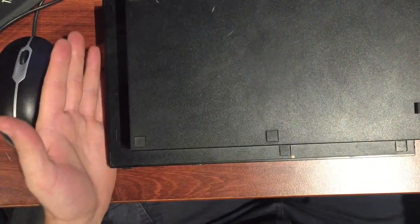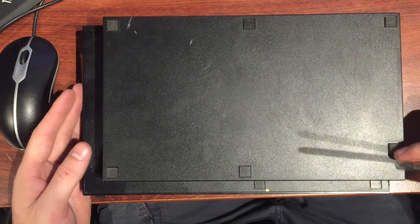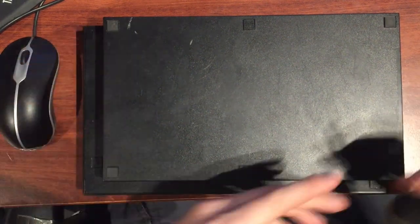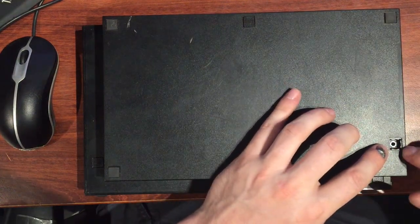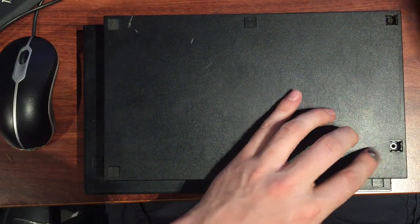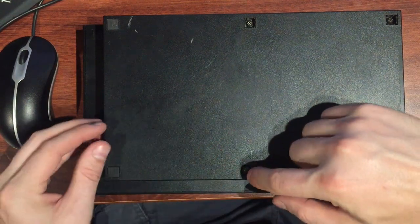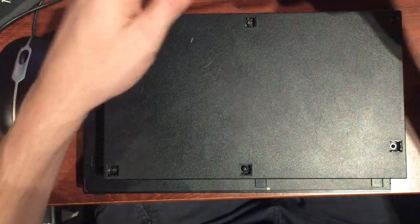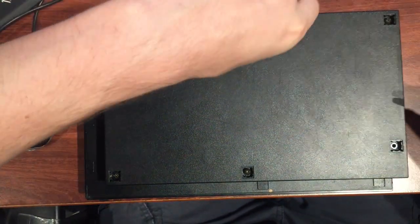So first thing we need to do today is pull it apart. I've never had this apart before — in fact, I've never pulled a PS2 apart before. So I'm guessing we take out these six points here, maybe some around the edge, and we'll work that out as we go. That was already half lifted out and the screw was missing — good start. Let's just grab a Phillips head and pull out the rest of them. That middle one was massive!